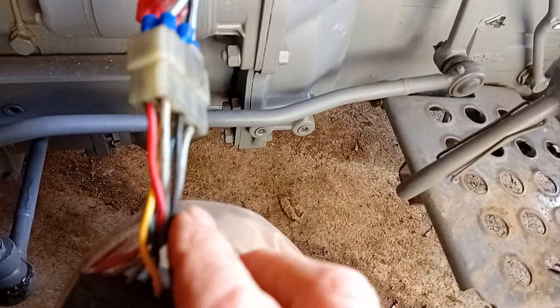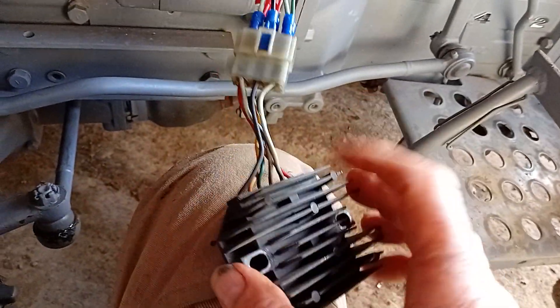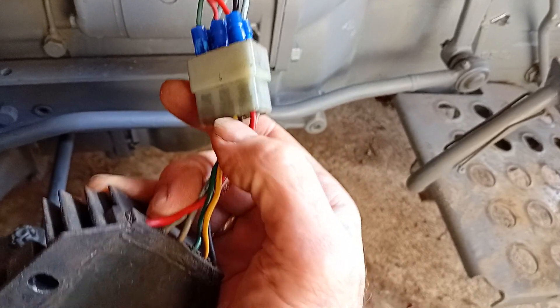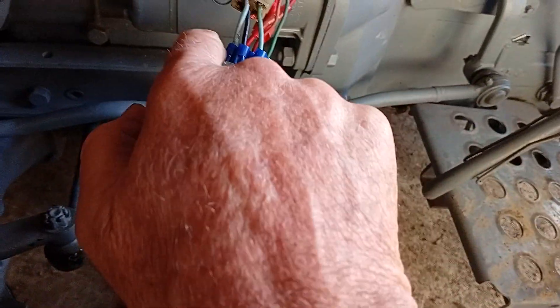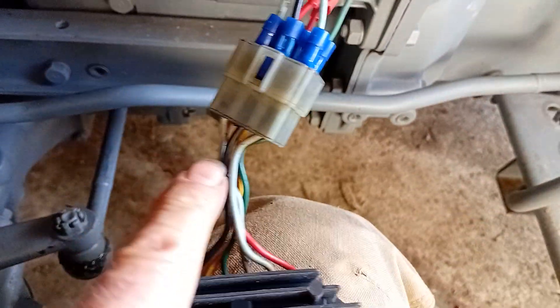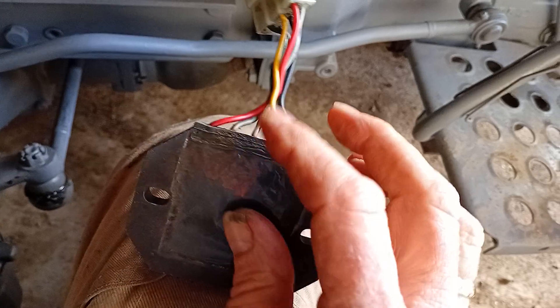Go to the red and the black wires and check on DC — you should have 14.2 volts coming out. In order to get that output voltage, the regulator needs to be told to turn on, so it needs ignition power on the yellow wire. If the yellow wire doesn't have power, the regulator won't turn on and you'll get nothing out. But if you have AC voltage coming in on the two blue wires, and the yellow wire has ignition voltage, and you still have no voltage on the red and black — the regulator is bad and needs to be replaced.